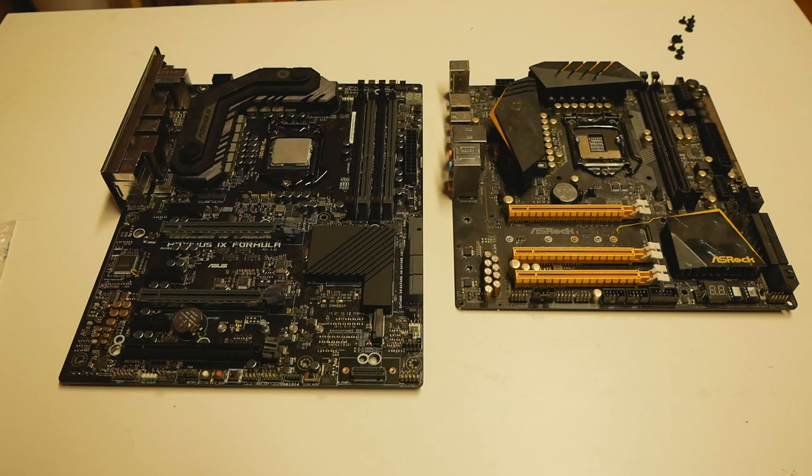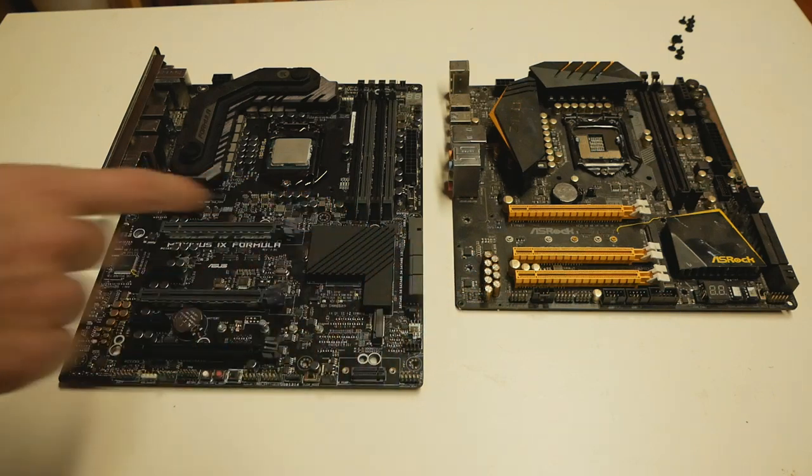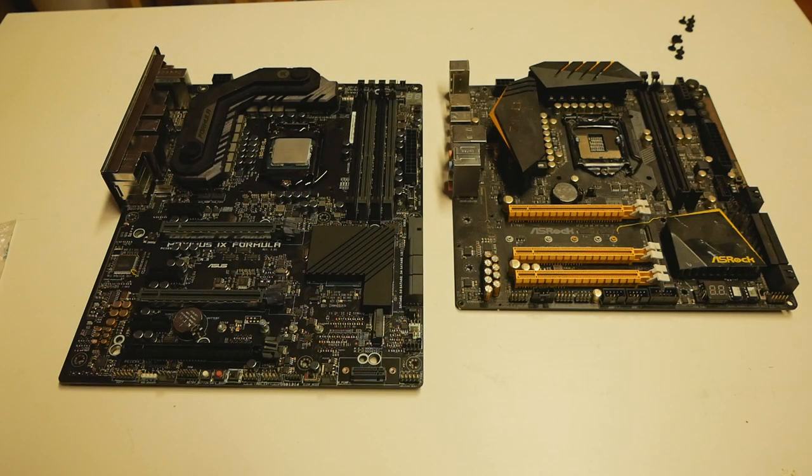And he asked me if I could do all the necessary modifications in order to run that newer CPU in the old motherboard, and I said yes, because I didn't really bother that much about modifying the BIOSes myself back in the day when the topic was more common in news at the tech media sites, because it was just so easy to run the newer CPUs with the MOCF. It wasn't only about saving cost. People wanted to keep going with the ASRock Z170M OC Formula because it's a really, really powerful motherboard.